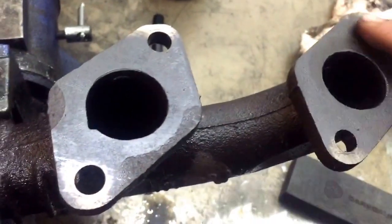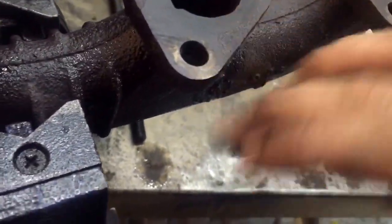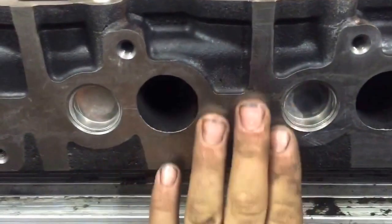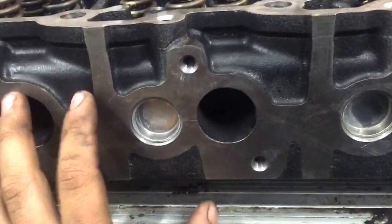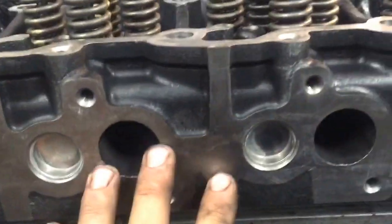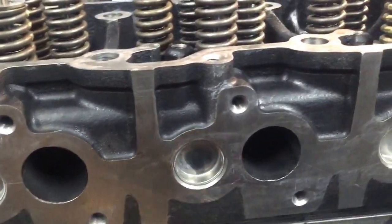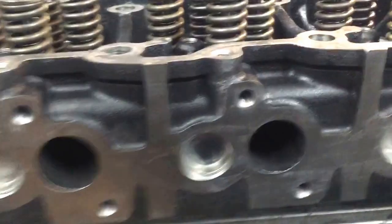But it's all you really need. This one could probably go a little more — it's got some grit here — but it's really all you need to get the metal cleaned up. Since this is machined flat, it's smooth and machined flat. I just want a good seal when I do stuff, and since I'm using a gasket as well, it's going to seal up pretty well. Anyways, this is how you stone stuff on a six-liter. If you have any questions, please comment below. If you like it, like it, and also subscribe. Thank you.